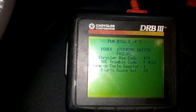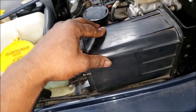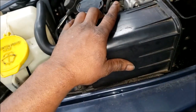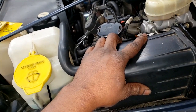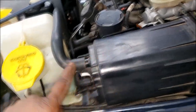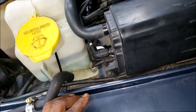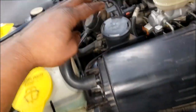Now we're gonna start with the EVAP system leak. Y'all know what that means — the system has detected that fuel vapors are escaping this vehicle. What I need to find that out is just a smoke machine. Let me go grab the smoke machine. Alright, let's troubleshoot the EVAP leak portion. This is my vapor canister right here guys — this is what is used to store those vapors. Remember the goal of the EVAP system: we don't want fuel vapors escaping into the atmosphere. Those vapors will be stored in here, and at a predetermined time the computer will purge those vapors using a purge valve and send them back to the engine to be burned.